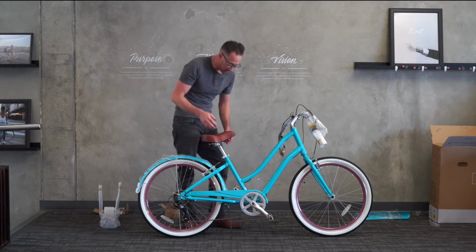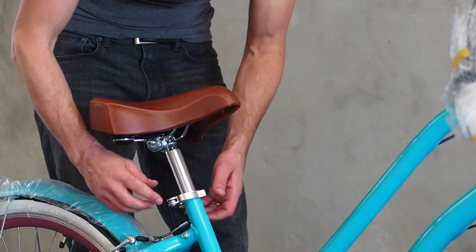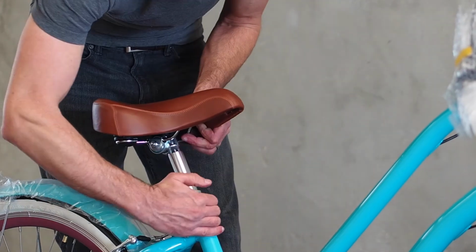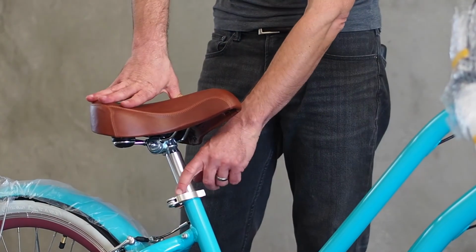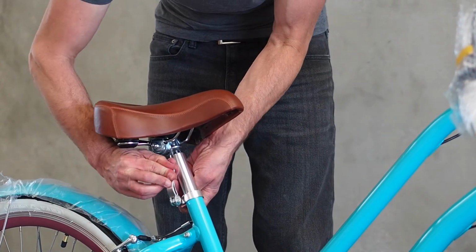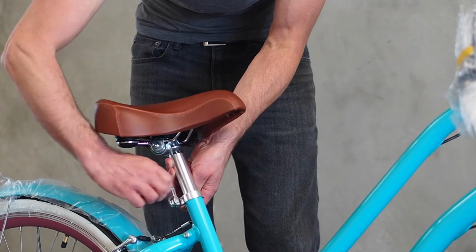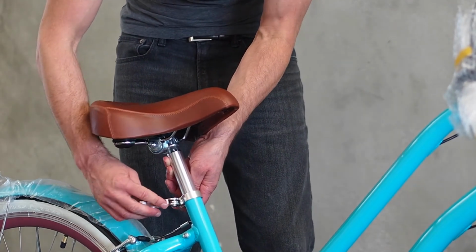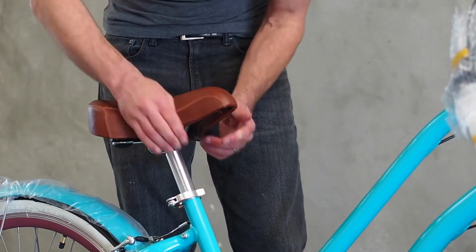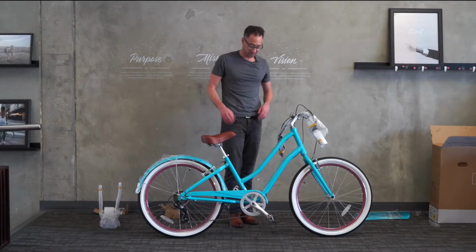Now, when you're using the quick release and you close it, it has to line up with the body of the seat post clamp. If it doesn't, you could break the seat post clamp by using too much torque. A lot of times we'll see that the seat post clamp will be locked upward or downward, or even towards the back. The fact of the matter is that the cam in here has a lot of torque in it, and can really break the bolt if it's not lined up properly with the body of the seat post clamp.